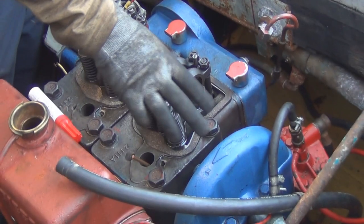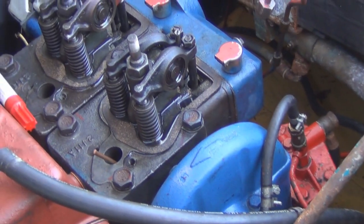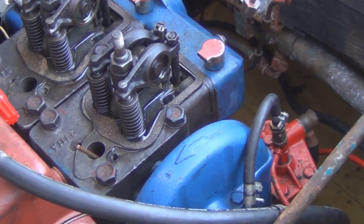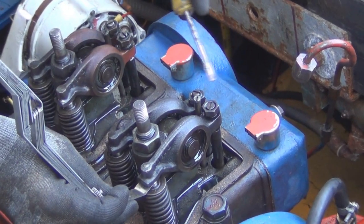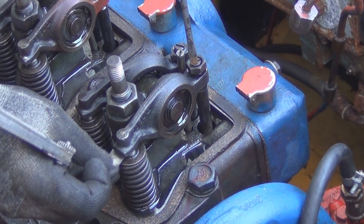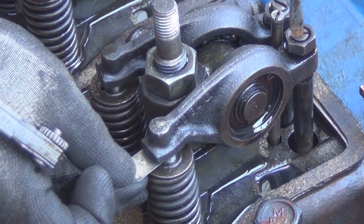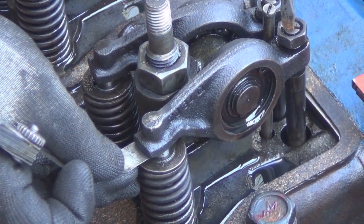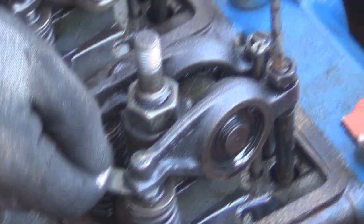This end one is your inlet valve which is currently all the way up and as the manual says 0.3mm on the feeler gauges. So you back your locking nut off and you slide your gauge in. You should be able to pull it out with just light resistance. Did you polish the contact points underneath? No, just cleaned them - no grit, no grunge. It's all cleaned and been oiled before.